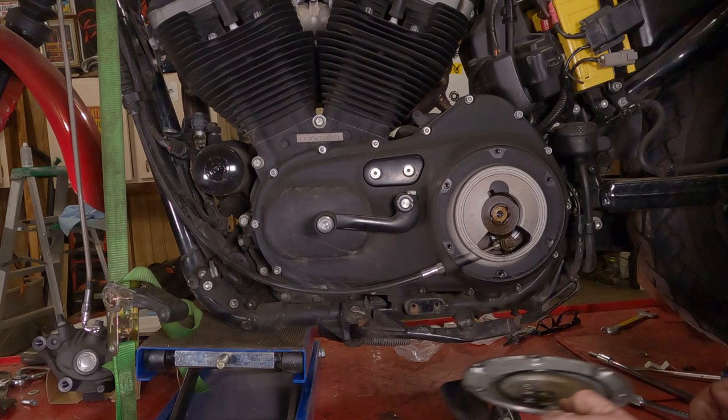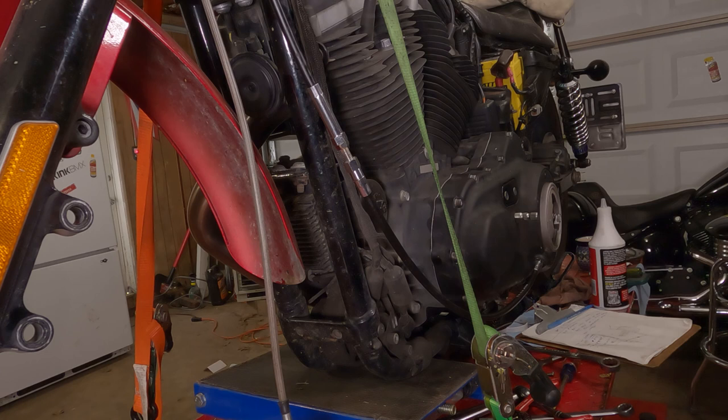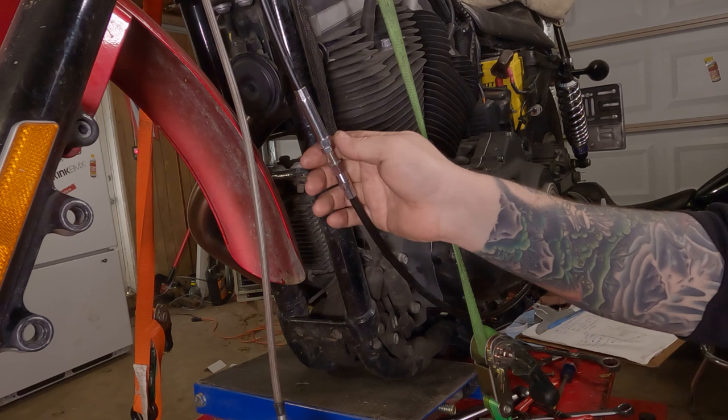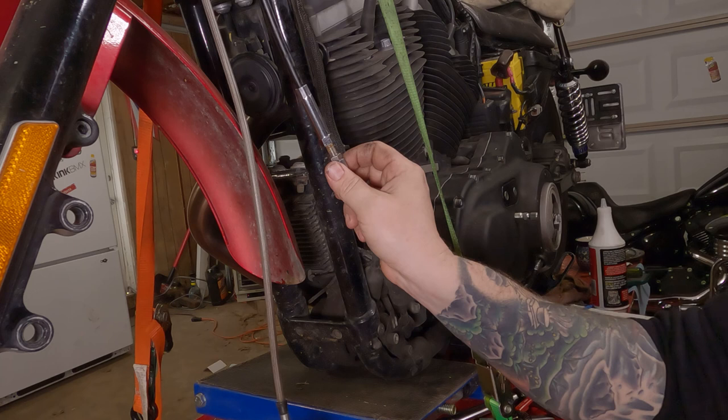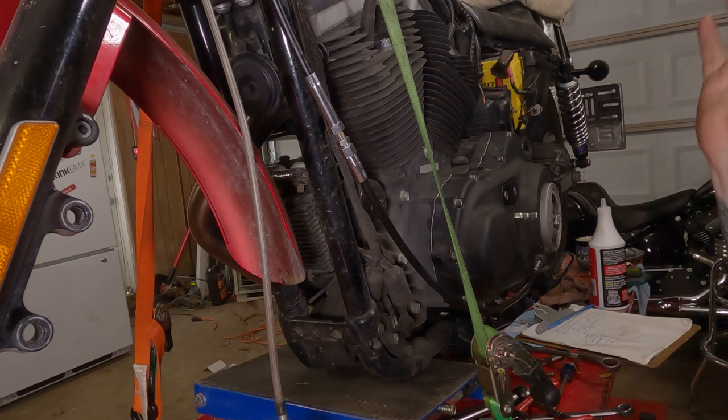When loosening your clutch cable, take your clips off or cut whatever zip ties, lift your rubber slinky up. Try to get it out of the way. Hold on to the cable with two wrenches. Loosen the jam nut up. Spin the jam nut way down out of the way. Then you can take this bottom section, which should spin, and thread it all the way in. Give you all the slack you need on the cable. That will help you get the clutch cable unhooked at either end. Clutch cable removal.